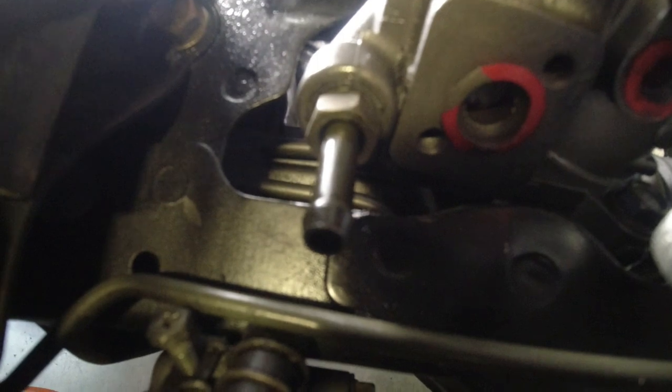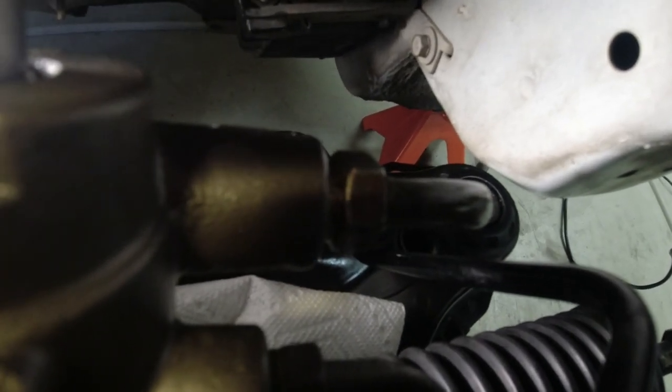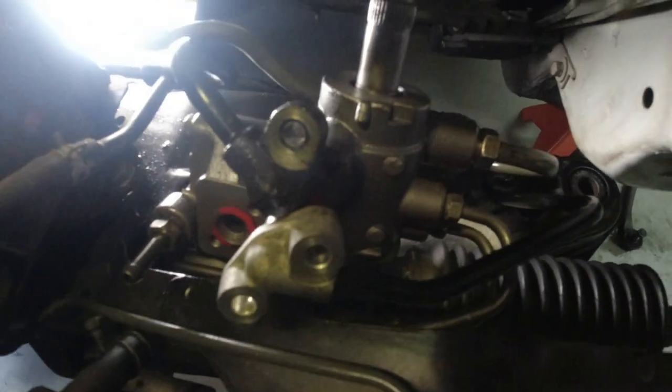Okay, I put that flare nut on. I just used a deep socket, 12 millimeter. Put that on. And just used a regular 17 to tighten that one down until the last turn. Then I use my flare wrench. If you have a crow's foot 17, it'll be really easy to do it from the side. I don't have a crow's foot 17, but you know, when you got the frame lowered, that's the time to do it. Now I'm just going to take off these two covers and do these other two. There's three 10 millimeter nuts.